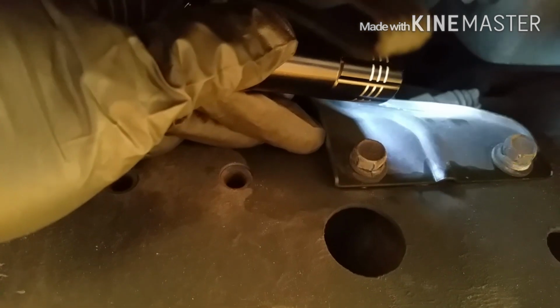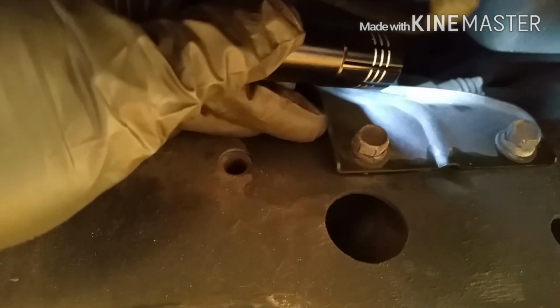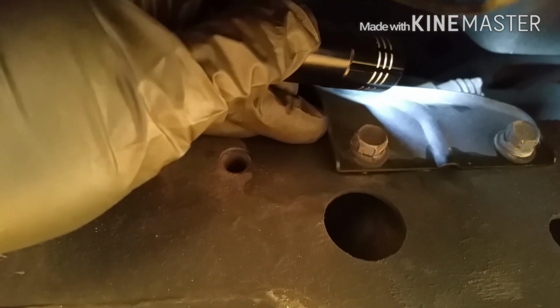There's the fuel filter. I already unscrewed the line there on that end. And over here you'll see a shot here. Can't get my phone in there. And that right there is a push style fitting there. You'll see where you have the squeeze, and it should pop right off that line on the fuel filter.